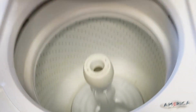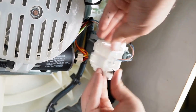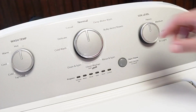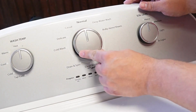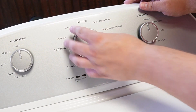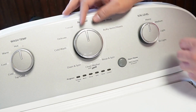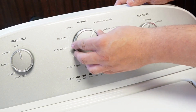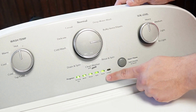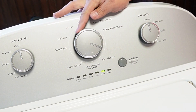Now that we've done the first reset, let's go ahead and attempt to recalibrate this washing machine through the calibration mode. This is a must-do if you've installed any new parts, from a board to a balancing rod. With the washing machine freshly rebooted, rotate the dial counterclockwise 360 degrees. Then turn the knob right three clicks, left once, then right once again. You need to do all these things within three seconds, and it may take a few attempts. If you've done this right, all the lights at the bottom of the washing machine control should flash on and off, showing that you've entered into the diagnostic mode.